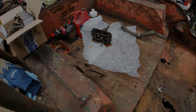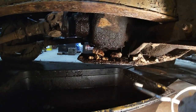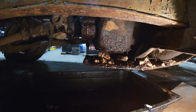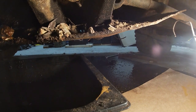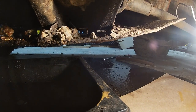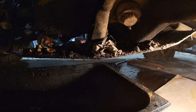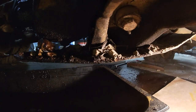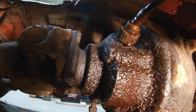Put the top of the shifter back on and see if this thing will pop out of gear or go into gear. The lighting situation is probably horrible, I understand — I just got my shop light down here. But I think I do have a little bit figured out on the transmission. It looks like the front seal is leaking, which is kind of throwing me off. I'm not sure if it's bad or if it's the fact that I've got the transmission completely filled — the amount of fluid I have in here right now is probably three times what it requires. You can see there's a seal on the back of the transmission, and it's leaking out of where the speedometer goes into the back of the tail shaft housing.